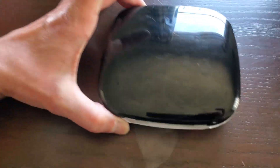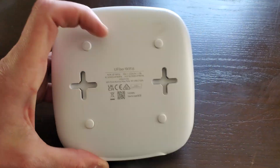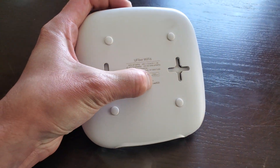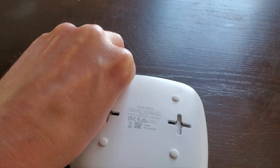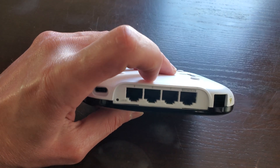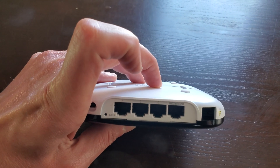We got another cat-damaged router here — Wi-Fi 6. It does not matter what the MAC address is; it's basically just going to be a test device. One thing I noticed is that there are no screws in this thing. It's very laptop-ish. I found a few tabs back here with my thumbnail. So I'm going to pop those two tabs and pry this lid off.